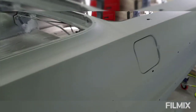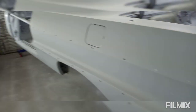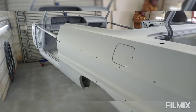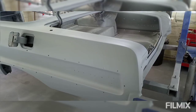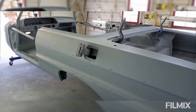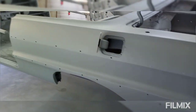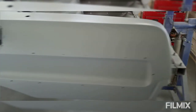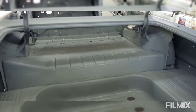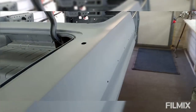Not a whole lot to show, but the body's getting there. We got this thing in two more coats of primer. Next step is we're going to guide coat this and hit it with 320, then probably primer maybe one more time and hit it with either 400 or 600 wet, and then seal it.